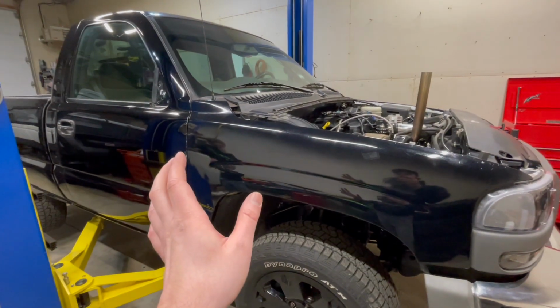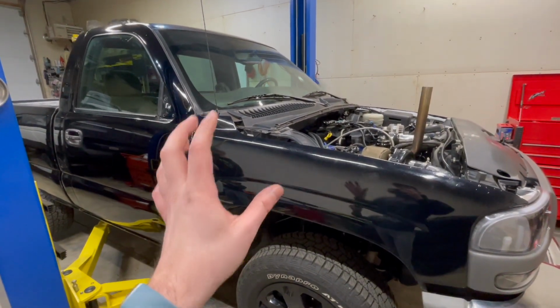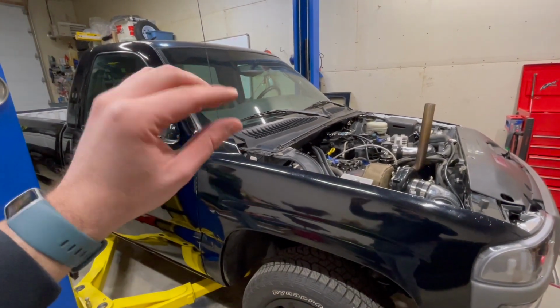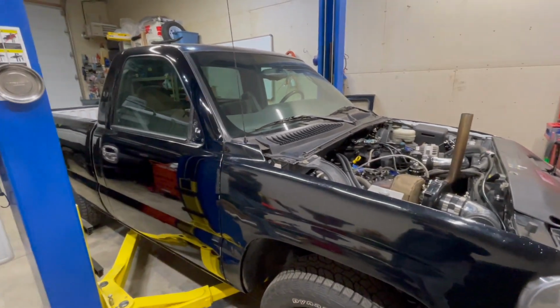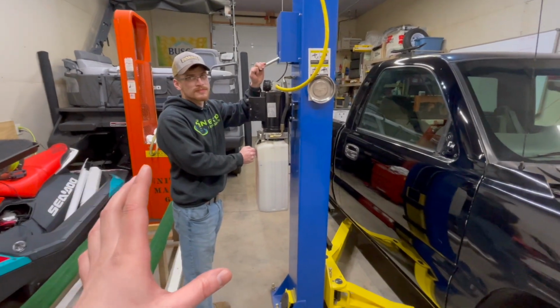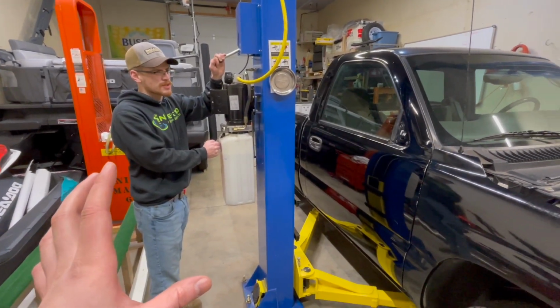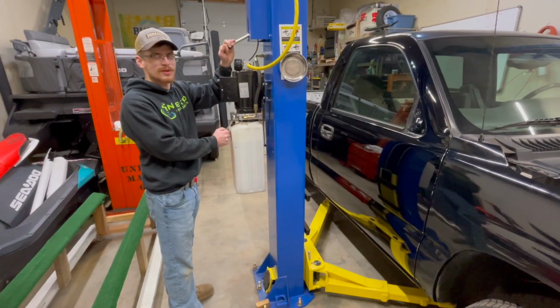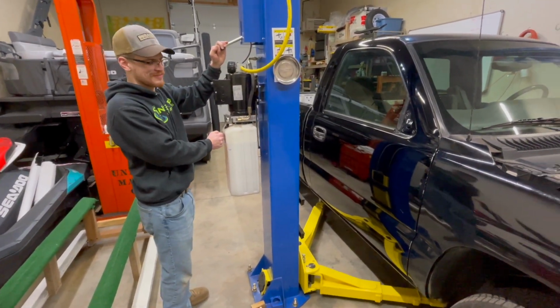We looked at the bolts for the flex plate and did not find anything like dripping from the bolts, and they look relatively dry. So we need an inspection camera to rule out the cam sensor. Once we rule out the cam sensor, then we know the trans is coming out. Yeah, that's a good point.